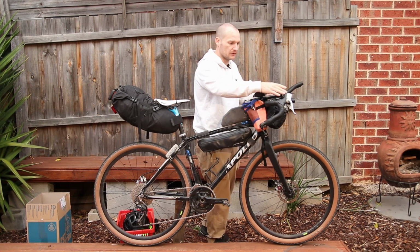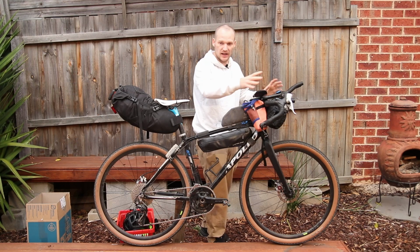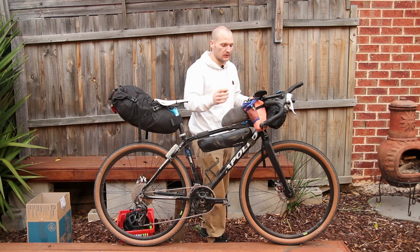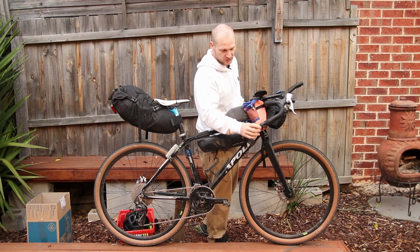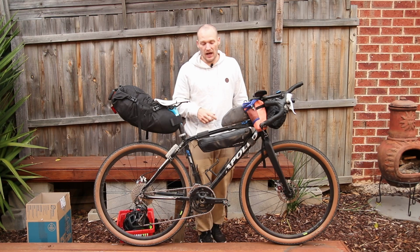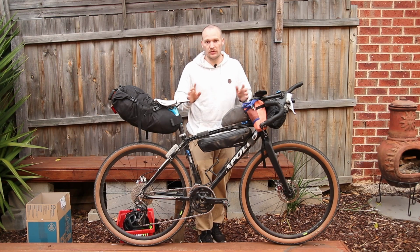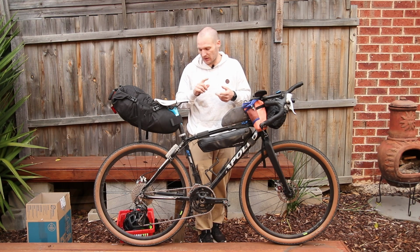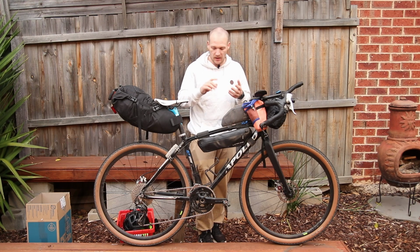That's just for brakes, mechanical, compressionless housing, gives a nice feel. But for shifting, I actually just use these 10-speed mountain bike bar end shifters. I don't even have them indexed. They're purely friction based, means I don't worry about any indexing. Doesn't matter if it's muddy, chocked up, nothing.